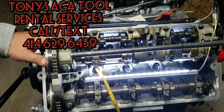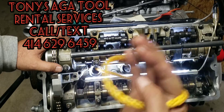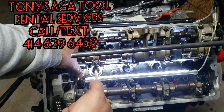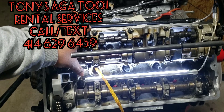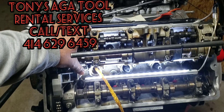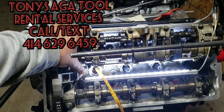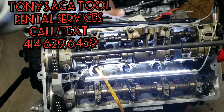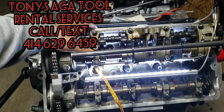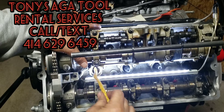A lot of you are going to say, 'If I drop a valve, I've got to pull the heads out' — no you don't. We're going to show you how to do that. Here's the rope, and no matter how hard you pull on it, you're not able to get it out. You can try to burn it or waste an hour, or just remove the intake manifold and get this job done quicker. This is all done with the engine in the car.